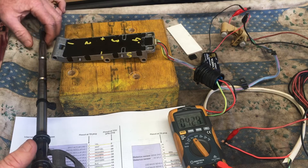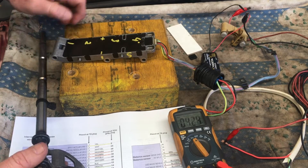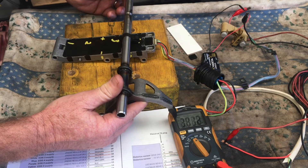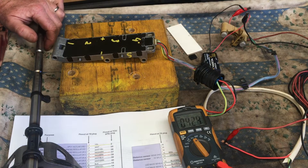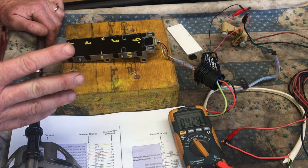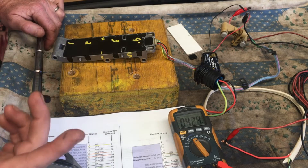Negative and positive are the distances that PWIS gives — zero at the centralized position, and a distance in millimeters either negative or positive based on the position. It seems a negative equates to an increase in voltage and a positive is a decrease in voltage. Interestingly, the response with no magnet nearby is a high voltage, which is the reverse of what I'd expect from a Hall sensor — I'd expect a very small output with no magnet close and an increase in voltage as it gets closer.